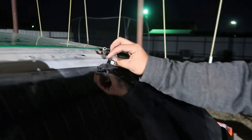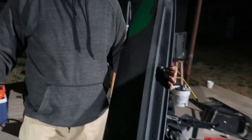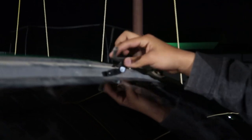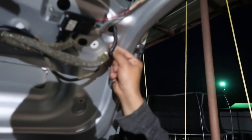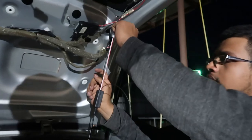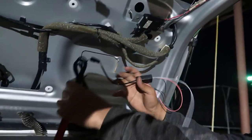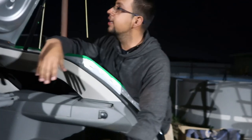Here's what I'm gonna do — this wire's for the third brake light. I was planning to mount a third brake light somewhere around here, but from the looks of it, it doesn't look all ugly and sketchy so I'm not gonna do that. What I'm doing for that third brake light is — I won't be needing all of this. I'm just gonna keep that washer fluid nozzle right here. So I'm gonna take this off, take this out. The wire comes from here, there's that tube hose for the water and the electric wire. If I just snip it or cut it out, I'll use this harness right here and tap it into these wires, wrap it somewhere here, and then this is gonna stick to the glass right there. Garbage, but it's gonna work fine.